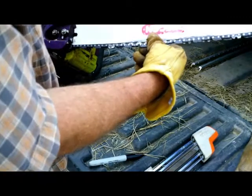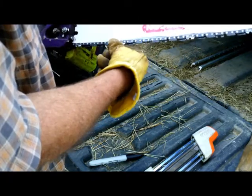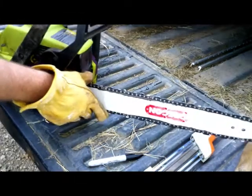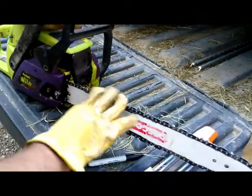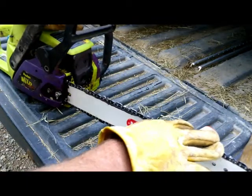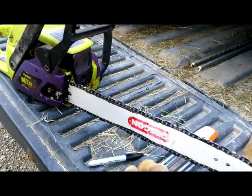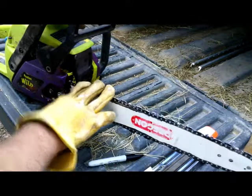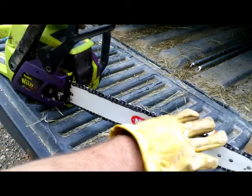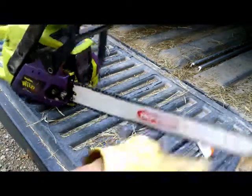The only other thing is when you first start out with a chainsaw, it takes you a while to figure out that if you cut way low on a stump, it dulls your chain because there's usually a bunch of dirt and stuff down low. So if I'm cutting a bunch of trees, I'll cut them up at a comfortable working height, and then come back later and deal with the stump. Because when you're limbing the tree and felling the tree, you don't want to have to mess around sharpening your chain. It's nice just to be able to have a sharp chain and keep going with it.